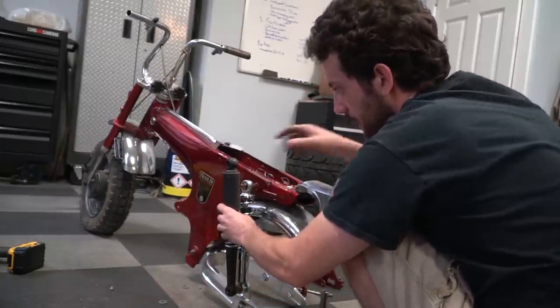So it is going to be slammed in the back. I'm finished up with the rear section of this Trail 70 build until I get tires in — then I can mount the wheels, hubs, brakes, and all that stuff. I'm stuck on the rear until I get those tubes and tires in. I had to redo some of the shims to fit the inner diameter of the bearing, so I'm moving on to the front.